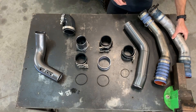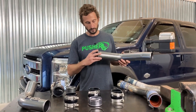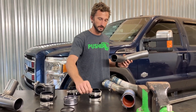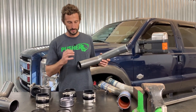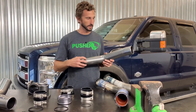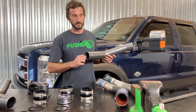This is the 2017 and newer model, and this is your 2011 to 2016 model. What we have is a full three-inch, mandrel bent, fully TIG welded assembly. We use the same C-clip connection — you're really forced to do that if you want to do this correctly — with an internal O-ring, a lot like this adapter. It's a standard O-ring, very easy to source. Then a nice heavy duty coupler and all stainless clamps. When you're shopping for this type of stuff, it's very important that you have the right size and designed machine adapter to go to that factory turbo outlet. A lot of stuff out there just has a butt connection where you clamp a coupler to the end of the turbo — that connection is not meant for that; it has sharp edges that will eventually cut into a coupler. TIG welding quality matters here too.